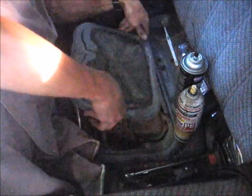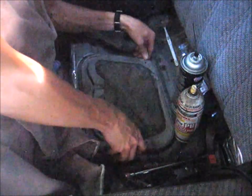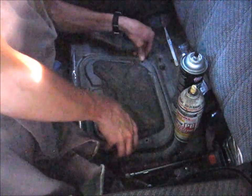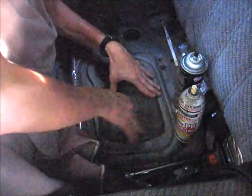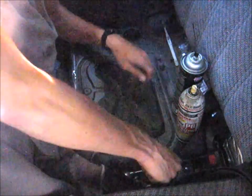Alright, I'm satisfied that I've done a leak-free repair. I'm going to go ahead and put this cover back on. If it's the first time you've had this off, you might want to replace that strip caulk that goes around there. But I've had this off before so that stuff is fairly new and pliable still, so I'm just going to put it back down with the same stuff.